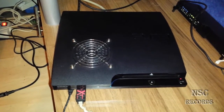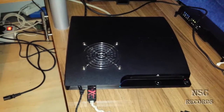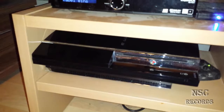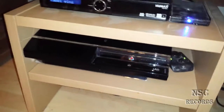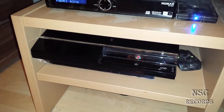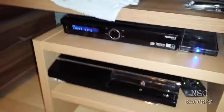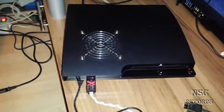I'm talking about if you have downgraded your PlayStation and flashed it with the E3 flasher or the E3 linker or whatever — then sometimes on some PlayStations you will have no display. That means the monitor stays blank. You mostly get this problem on the PlayStation 3 fat editions on the CECHK 0304 or 01 — you will have no display after you have flashed it.